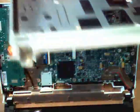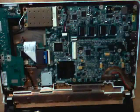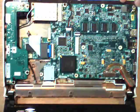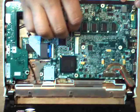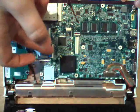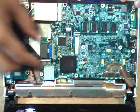Just kind of slide your fingernail around the creases, and boom — you're home free. The nice thing about this top part is after you get the screws and the touchpad and the keyboard cable unhooked, there's no other cables coming up through that you have to worry about, so just set it to the side. Now that we've got this part exposed, we need to remove this tricolor cable and this ribbon cable right here.